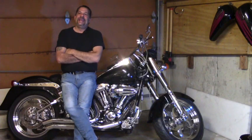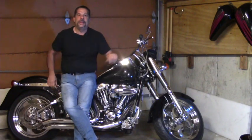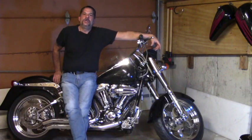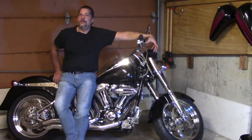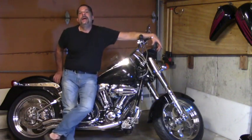Anyways, Gary, you've got to do some research. Don't trust, I shouldn't say don't trust, don't live or die by that voltage gauge in the fairing. Always go directly to the battery with a good voltmeter, DC voltage, 0 to 20 range. Make sure it's getting 13.8 to 14.8 volts DC input right back to the battery, right off the bat.